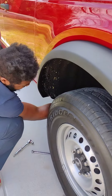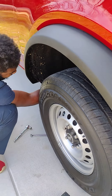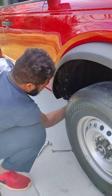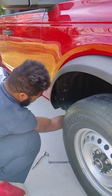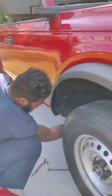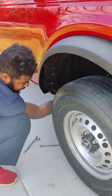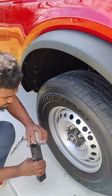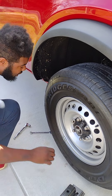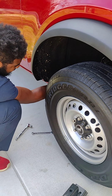Always thread them all the way in by hand. If you have an air wrench or impact wrench, you can use it to put them back in - it might fit, it might not fit - but these don't require a significant amount of torque to stay held in. Unless you have a spacer - because these come with spacers inside to prevent them from being crushed - do not overtighten. You'll never be able to put that back in correctly unless you bang them in.